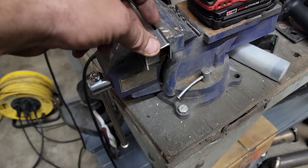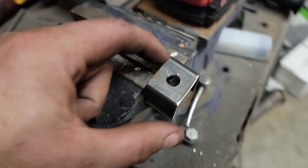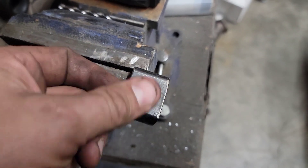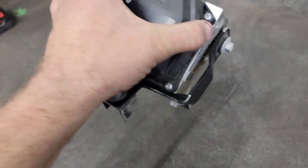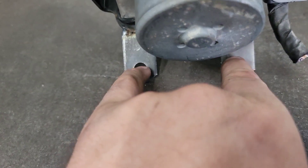I've got a little square tube with one of the ends cut off, made into a standoff bracket. I've drilled a hole in the center and we're going to put a rivnut in the middle so we can bolt the bracket to it. We'll put a weld here onto the body and a weld here onto the body, then do the same two rivnuts for the top holes. We've got an M6 rivnut in it and the bolt is in. Next I'll put it back in the car, get it at the right angle, weld each one of these ends, then drill two more holes, put in two more M6 rivnuts, and she'll be bolted down.